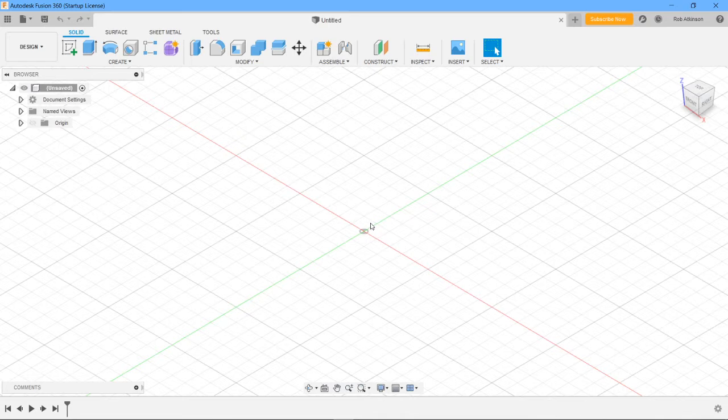So I took it to bits. It's a good Hoover, nothing wrong with it. You just need a new motor. The tang inside the motor had snapped off due to condensation and corrosion. So why am I doing this video?